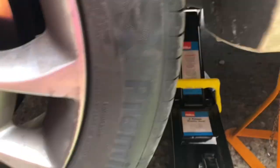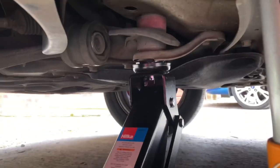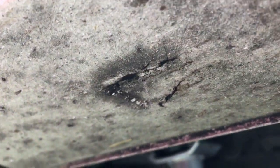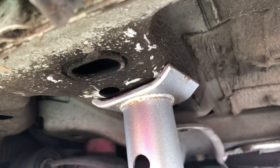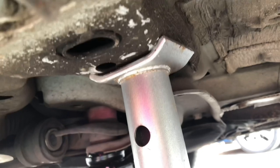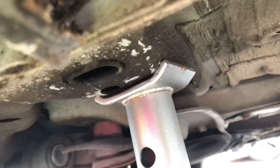Right guys, the car's jacked up now. I'll just show you — for those who don't know — where the jack point is. I'll use that point in there. You can obviously use the ball right here, or you can use the jacking points with the arrow. That's if you use a standard jack. You can still use a trolley jack on there, but I'd rather do it on a flat bit, same as the axle stand on that bit there.